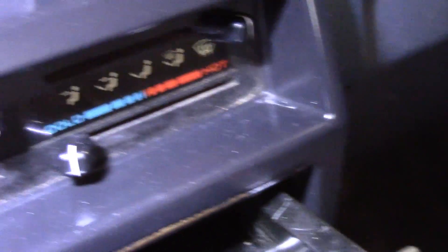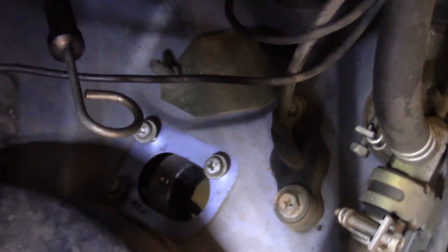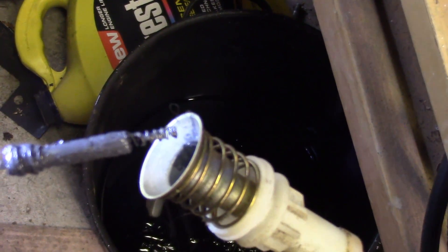We also cleaned up all this and the front of the dash and got that done. Right now I'm just waiting for a new speedometer cable to come in — I found one on eBay that I'm hoping will work. It just comes out of the firewall right in the corner down there. See, there's the hole. It just comes out and goes underneath the truck. It's spring loaded and hooks up. And this is what busted — it busted and came apart.